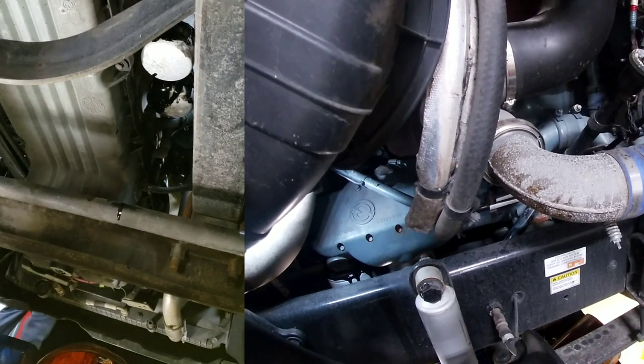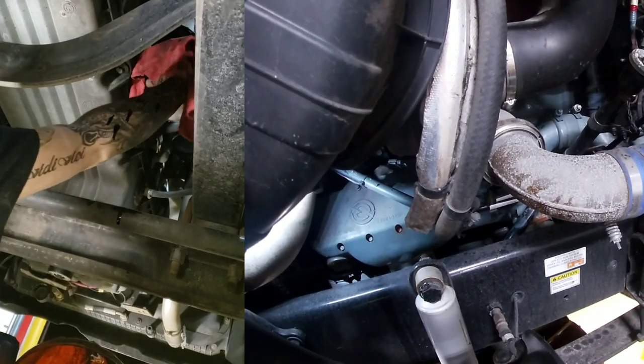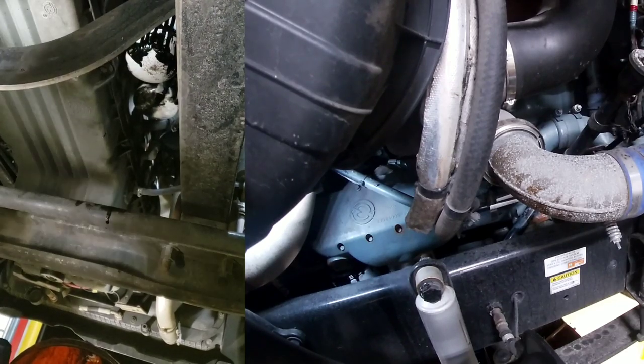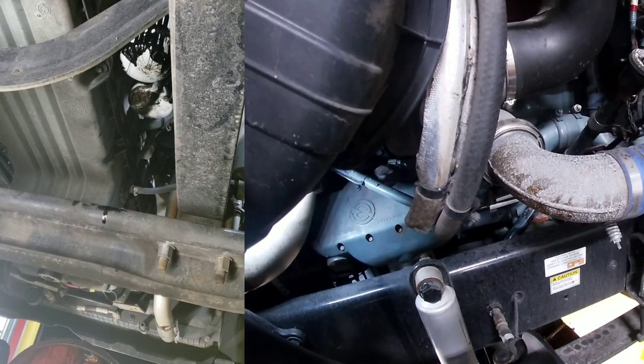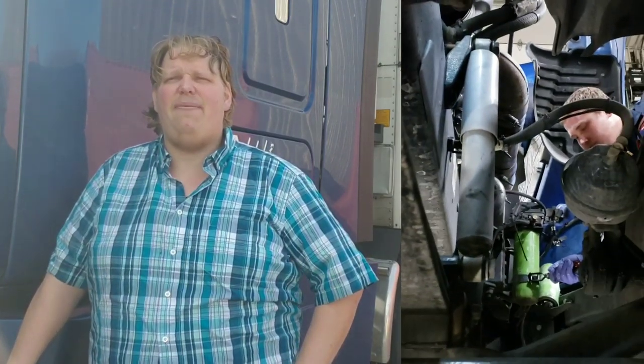Just make sure you have a decent amount of miles on that system when you're taking the sample, because you want something substantial enough on there to show some dirt. If you don't have a bypass filtration setup, by the time you get to the normal 4,000, 5,000 miles... actually, nowadays they're doing this intelligent oil monitor type stuff. So let's say you're at 8,000 miles and your oil life monitor says it's time to change your oil. You can take a sample then.